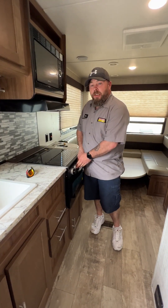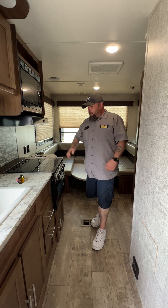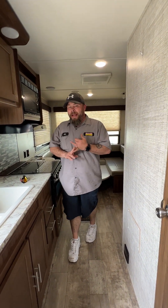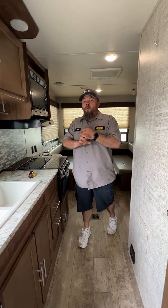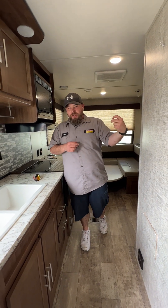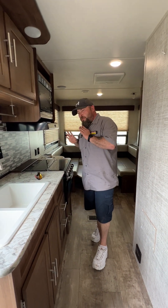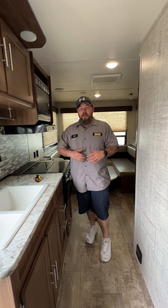Even in my friend's situation while he was trying to load his fridge, his belt loop or something caught his stove knob and turned it to the on position. Always please be mindful of that. Check the stove — if nothing is on, we turn it back on. If it starts going off again, turn it off and go have it serviced. Usually the two main places that propane comes inside the coach are your stove and your furnace. Usually if you have a fridge that is gas or electric, that connection is on the outside, same with the water heater. So your two main places are usually going to be stove or furnace.